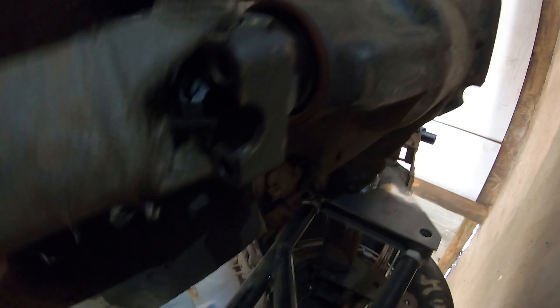I think he's correct. This is the SVO driveshaft at 45 and a half inches — it bottomed all the way out on the transmission. It would work, but with the articulation of the rear end it's not going to work out. About an inch shorter than what's here is 44 and a half, and that's what 79 Beans put in the comments. So if you want to look super smart in the comments, put your guesses for the next thing.